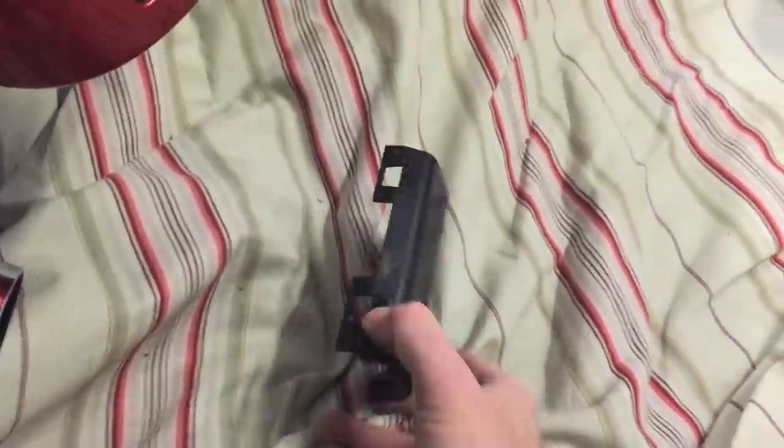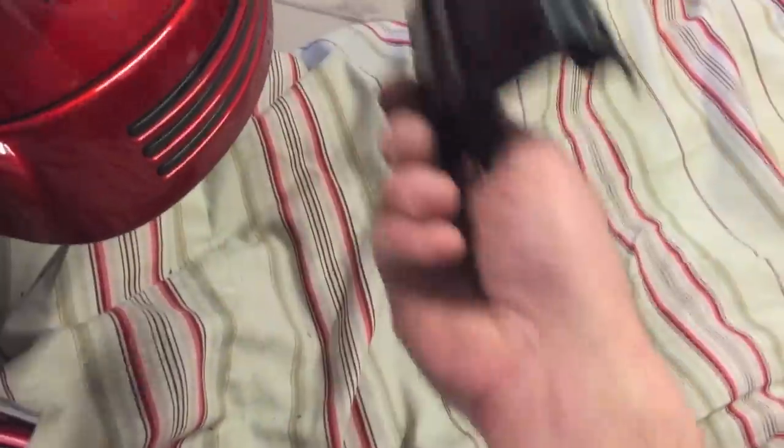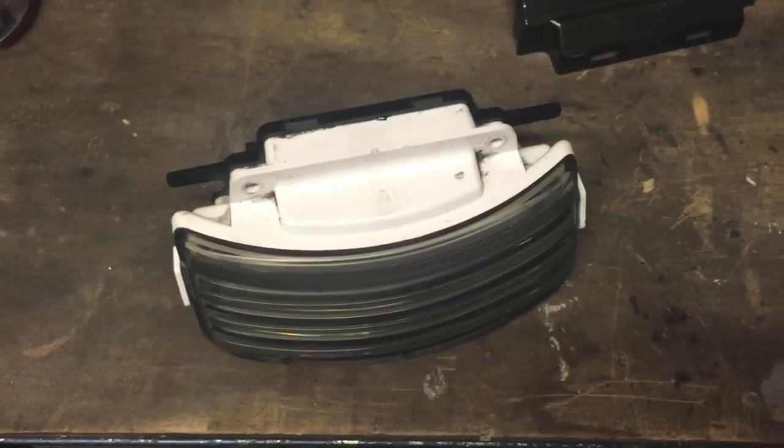To get to it, you've got to take off this plastic cover. Once you pop the plastic cover off the bottom, just get a screwdriver under these two little tabs here and pop it off the little white tabs from the light, rotate it up and get it off the top of them. There's one 7/16ths bolt in the back of the license plate cover that holds the wiring off of the rear wheel while it makes its way up to the lights.